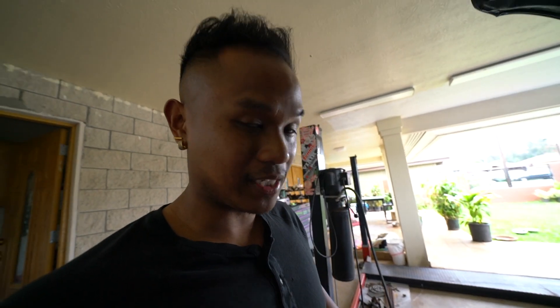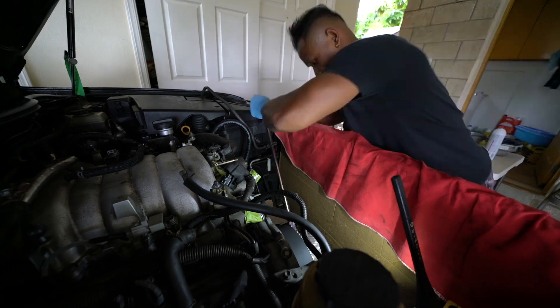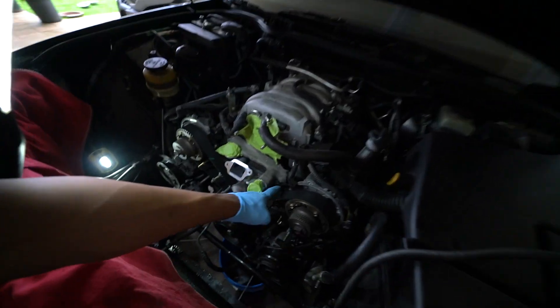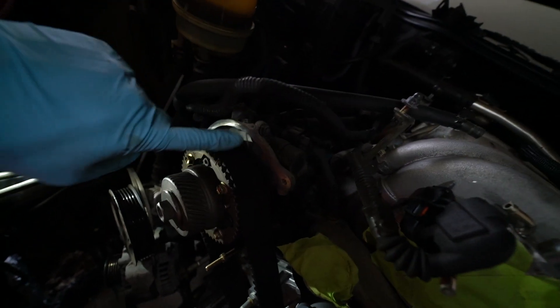It'll probably take a few turns to rotate the whole assembly one time to get everything lined back up. Looks good to go. Here's a tip: when you're originally lining up the pins, I had labels — 'R cam' on the right cam, 'L cam' on the left cam, and 'crank.' Don't pay attention to those after you start rotating. What you want to look at is the marks on the actual gear — there's a mark right here, line it up with the cover, same for the other one, and the crank is on zero.